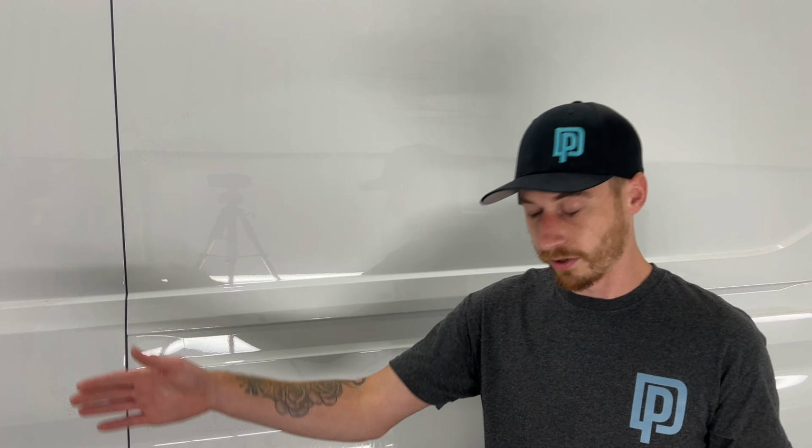Another thing to look out for and to do when you're wrapping a vehicle, depending on what kind of vehicle you're doing and what style of wrap you're doing, if it's a commercial wrap, this can vary, and if it's a color change wrap, is disassembly. Disassembling a vehicle is part of prepping for a wrap. Normally, I like to do my initial clean, then I'll disassemble, and then I'll go back in and clay bar and then do my alcohol wipe, because it gets more in depth, right? So like on a van like this, are you taking apart the plastic trim on the doors? Are you taking the rockers off? Are you taking the wheel well covers off? Mirrors, door handles, all that stuff. That all comes into play with the prep of wrapping whatever you're wrapping.